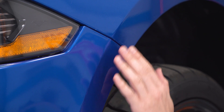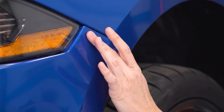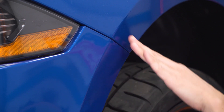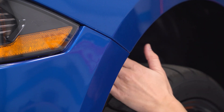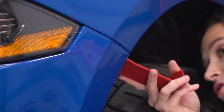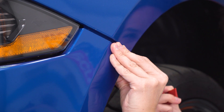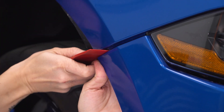At this point, we can release the side of the bumper. Right in between those two nuts that you took off, there is a pop clip attached to a bracket, so you need to release this to release the bumper. You can go in from the side, but if you're concerned about the paint and you still have the wheel well liner out of the way, you can get at it from the back. Just go in between the bracket and release it. Repeat that on the other side.